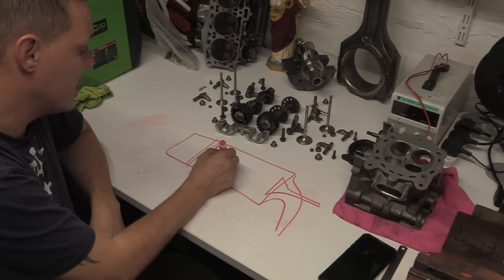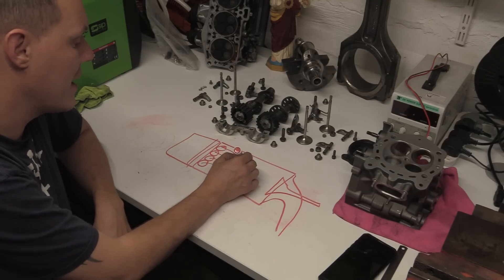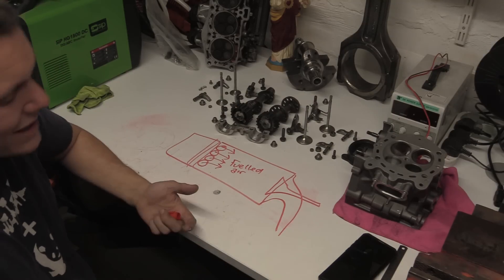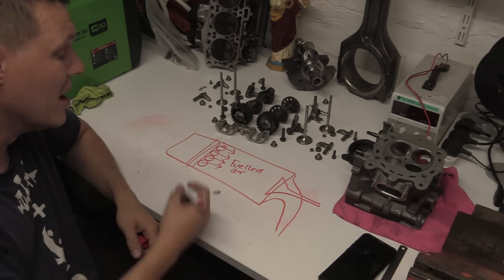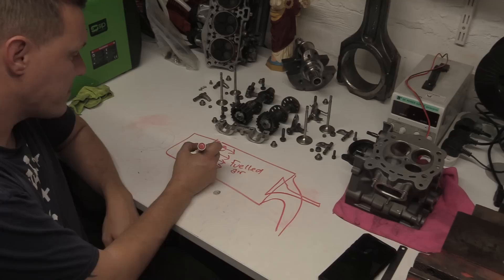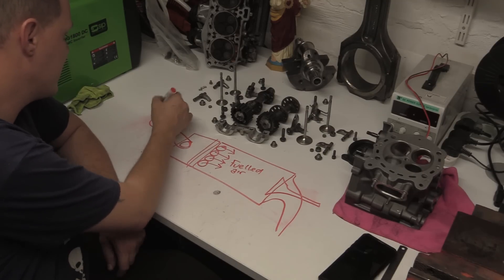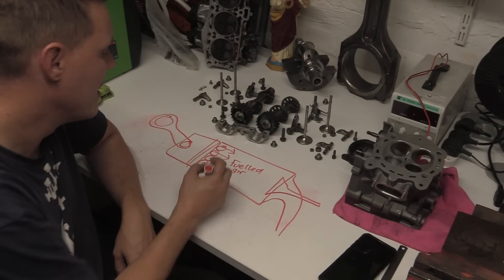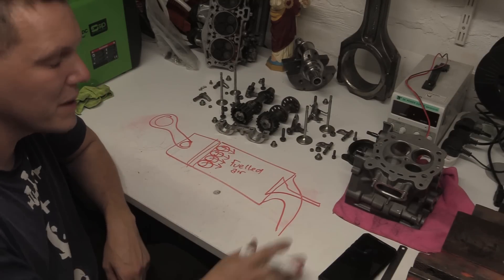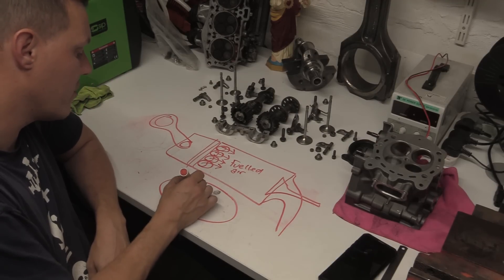...and you open the ports — they flood through. But if this were petrol, the air-fuel mixture would just go straight out the exhaust. Same problems: oiling, washing the cylinder walls. Even with a sealed bottom, oil is going to scrape off on those ports — that's still a problem. And then there's the forced induction issue on top of that.